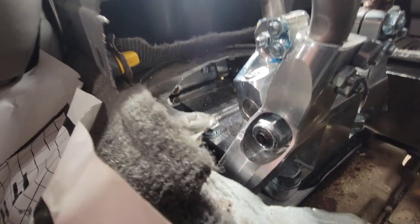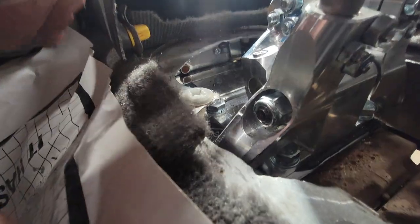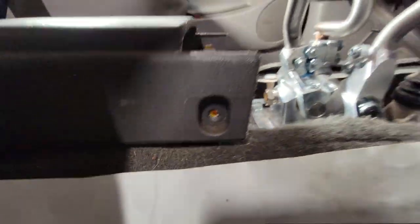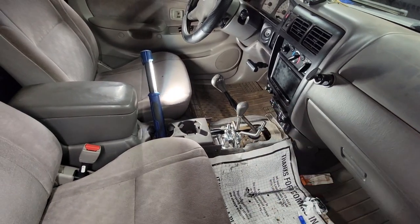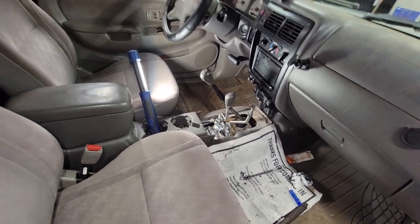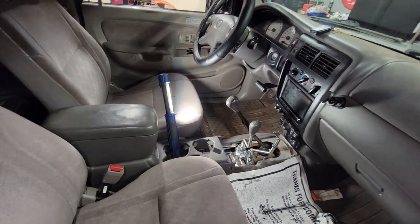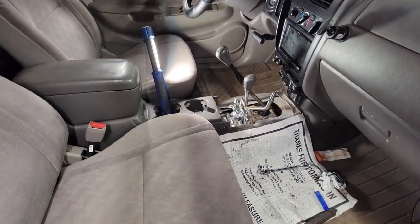I had nasty vibration noises, and in there, that block right there is the top of the transfer case that came with the truck. I had to raise the floorboard. You can see I got a little gap on my plastic panel now. Had to raise the floorboard because it was vibrating underneath it. And yeah, that was kind of a pain in the dick. All I did is I took a pry bar this way underneath, hammered it underneath it. It bent the floor up. And you can't even really tell inside, but it made all the difference and now it's quiet.